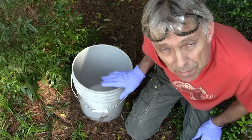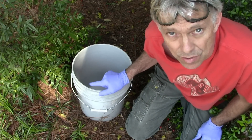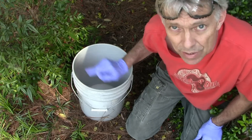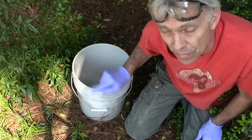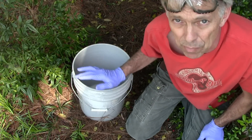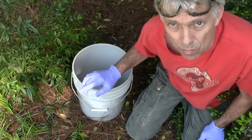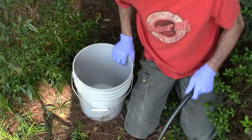Okay, I've got a five-gallon bucket here. I'm going to fill this up with water and then add the sodium hydroxide crystals to this — never ever the other way around. Also never ever to hot water; it'll boil and splatter. Not pretty. Also, this stuff makes a gas — I'll explain a little more about that later. Let's fill this up.